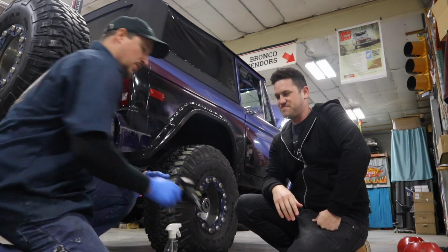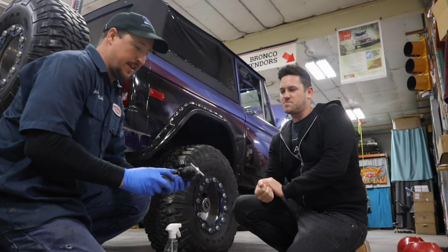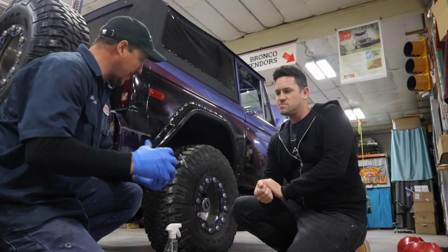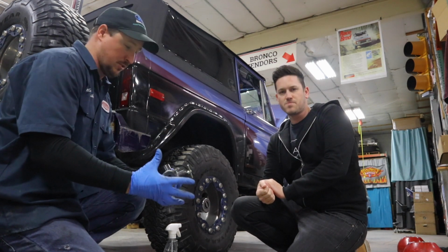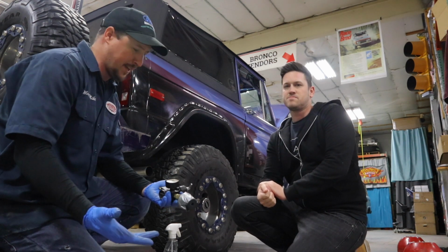There's a lot of different ways to do this, but what I'm trying to do is two things. I'm trying to seal the end of the tailpipe so I can get air in there and trapped so it actually shows us any leaks. And two, I'm trying to regulate the air. I don't want 120 PSI going through there.